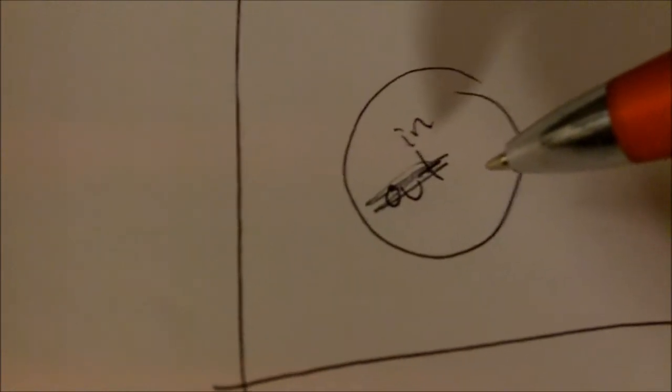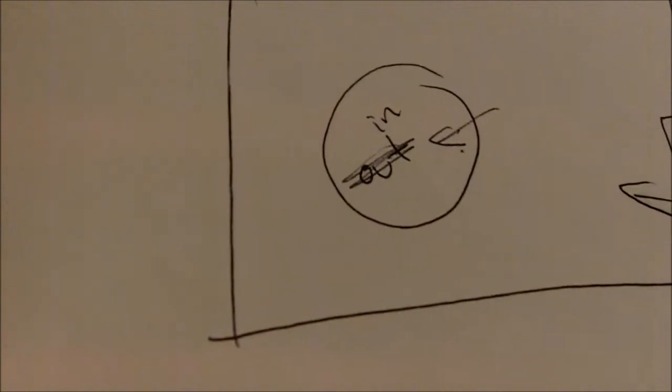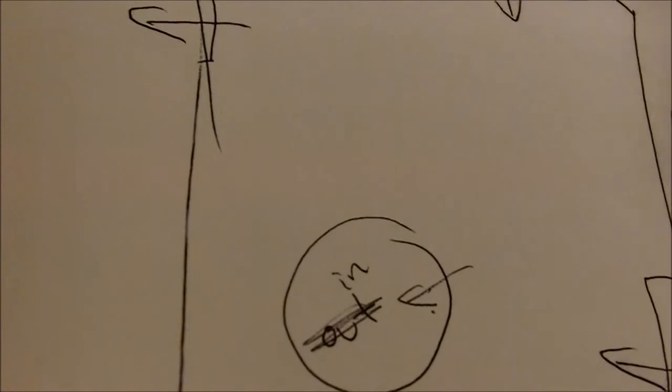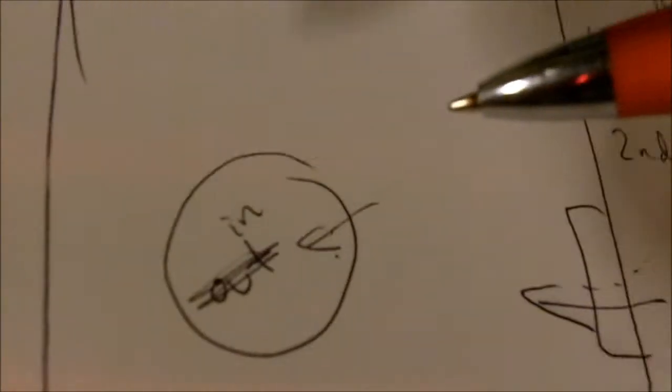Essentially, this one right now is a Zigmatech fan that I can't mount either way, so it's pulling air out of the case instead of in. I don't have it turned on right now, because that would be too much air going out of the case, not enough going in. So I've got this fan at 100%, these fans at 40%, and this one's not even plugged in. I'm trying to keep it close to middle ground, maybe a little more air coming in than going out.